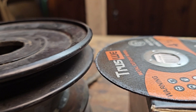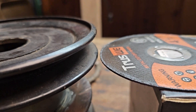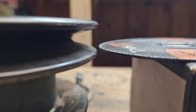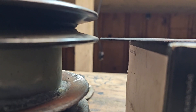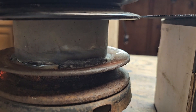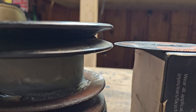Now watch what's going on here. The gap is good enough — it's just a lawnmower. But this pulley — slow right there — and there, it's coming up. Now you gotta find the high spot. That's where you want to make your first weld. You either gotta weld it there or take a little bit off and get it level. You can't have too much of this — too much is gonna be bad. Let's straighten that out by hand.